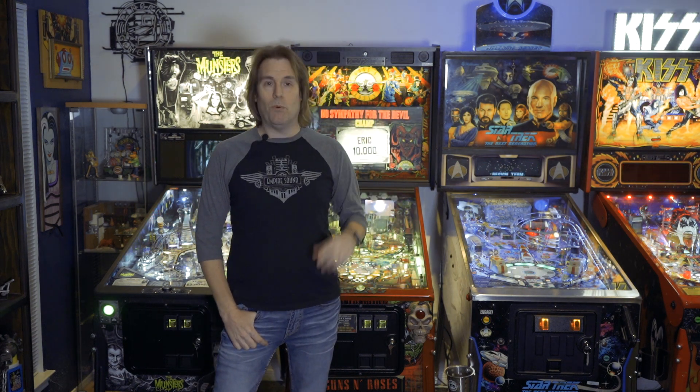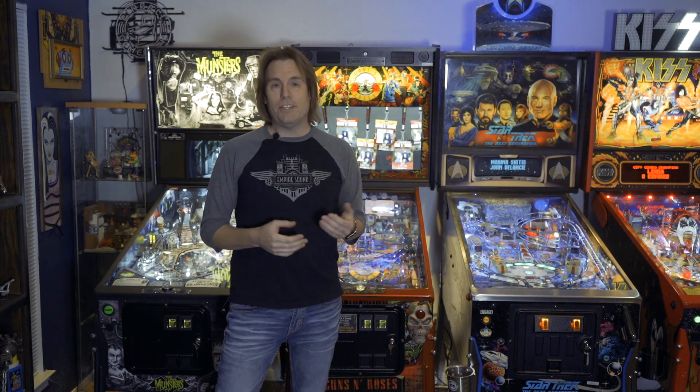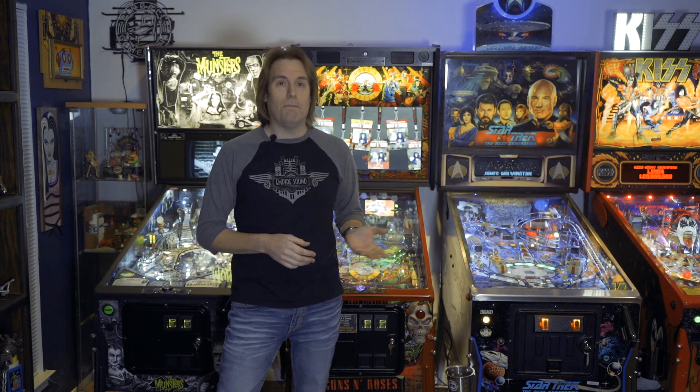I think it made a huge difference. I thought the amp that came with the Guns N' Roses on the factory board was just weak on the low end, and there's no EQ adjustment like there is on Stern machines. So until they get that sorted out with the programming, I think this is a great option to add extra low end without having to go to an external sub or a whole new speaker system. You can also use this amp on other pinball machines — make sure you've got upgraded speakers like from Flipper Fidelity or Pinball Pro. I wouldn't recommend it on a stock speaker system unless you've got a really good sized magnet, because the 100 watts this amp is putting out could pop that speaker. Thanks for watching and keep flippin'!